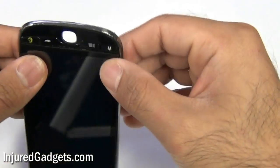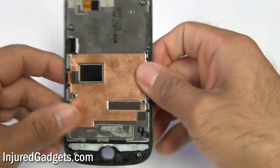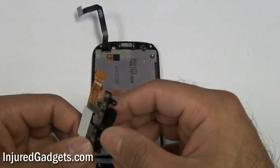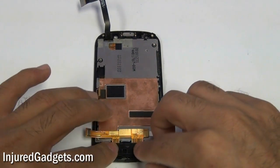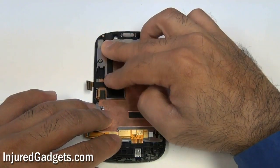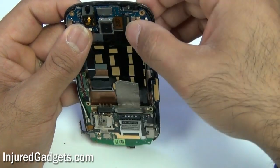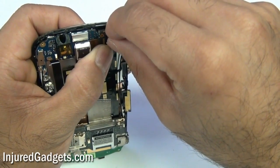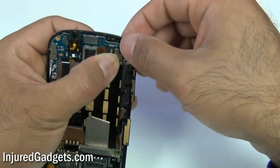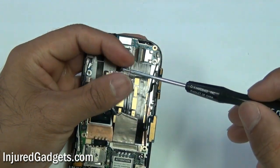Make sure to push down the sides and ensure it's a nice tight fit. Sometimes I'll apply heat here so that the adhesive re-secures itself to the back housing. If your keypad flex popped out, now would be a good time to put it right back in. Before putting your motherboard back inside the phone, take the digitizer cable, fold it down, and make sure it comes out on the left-hand side because it will need to plug into the board later. Place the board on the frame of the phone and make sure it's clipped in properly — there are little clips on the top left side and the right side. Make sure the board goes under these clips; if it doesn't, the board won't sit flush. Push that power flex cable back in, hold the board in place, and go ahead and screw in a few screws to secure it.